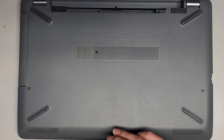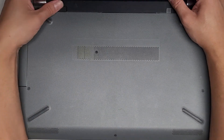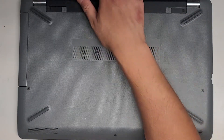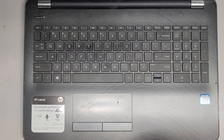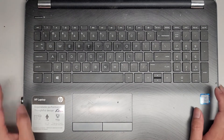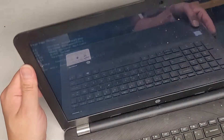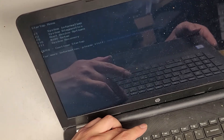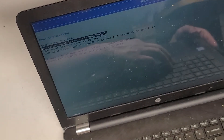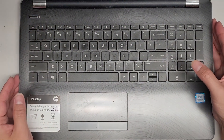We'll do a clean install of Windows onto it. Get the battery back in — line it up, push it into place, lock that down. If you're wondering how you boot to the USB — basically you power it up, put in your Windows USB installer, press Escape on boot. Here you'll see it gives you the options for system information, diagnostics, boot device options, BIOS, and system recovery. We're going to go to F9 for the boot options. You'll see the USB drive — I'm going to boot from my SanDisk Cruiser Fit on UEFI. We're going to install Windows 10, and that's pretty much it — just go through the install as usual. Thanks for watching and I'll see you all in the next one.